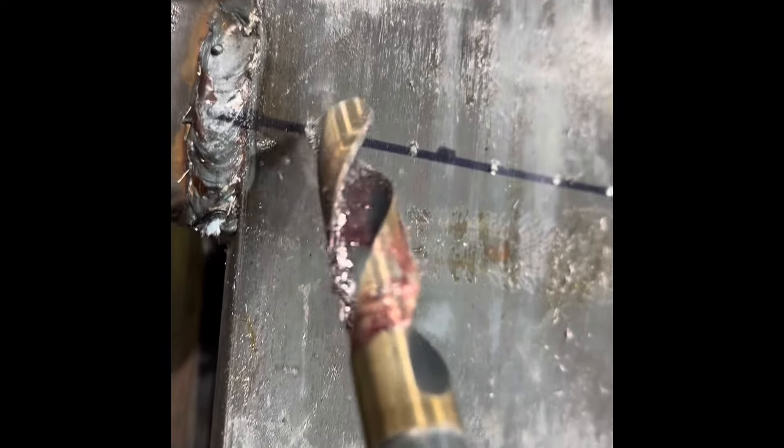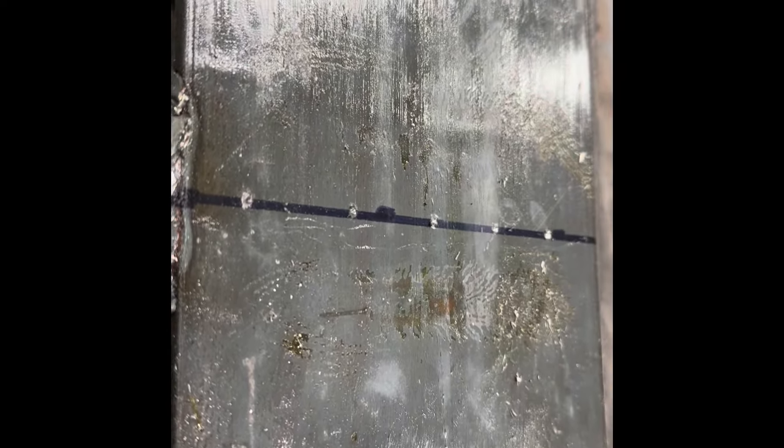I was doing some thinking and decided I wanted to plug weld along this center line right here. I didn't mark these out because they're just going to be plug welds. I'm going to use this big drill, send in maybe an eighth as a pilot and then drill the rest. I just took a punch to get those marked — close enough, I call that good, eye certified. I could have even staggered them, but I think down the middle is going to be okay.